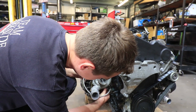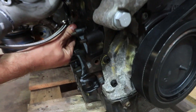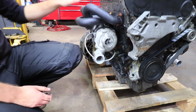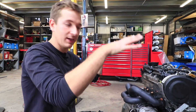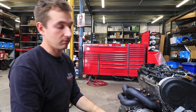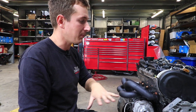Standard oil return — this is the same one as what the normal Mk4 Golf bottom mount stuff runs. The idea with this turbo setup: normally it's top mounted and your turbo's about here, but we've gone bottom mounted to get the weight as low down as possible so that you've got a good centre of gravity. A lot of race cars would go even further and try to put turbos even lower, but we're keeping it simple — this is sort of off the shelf.